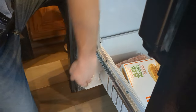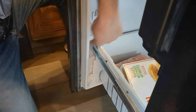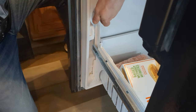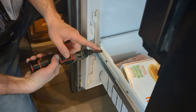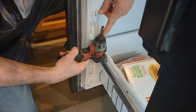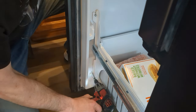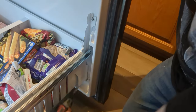It takes just a couple more seconds to remove the stuff here. For this bottom rack there are four screws on the back of your door that opens and closes — two on this side, two on the other side — and you're going to loosen these up. You don't even have to take these all the way out; that allows you to pull up on this door. I'm using my bit holder — if you were using a wrench you could use a flathead screwdriver. This is a quarter inch size, so that's what you need.